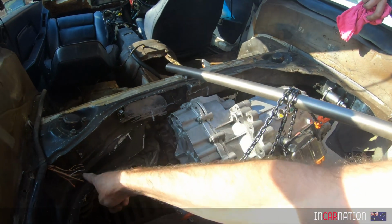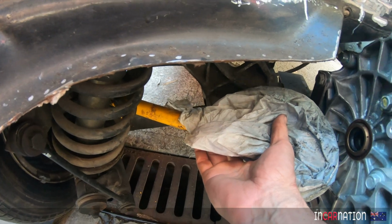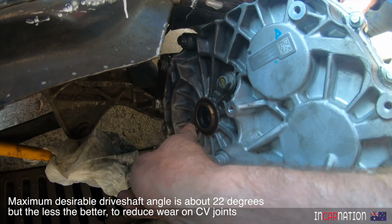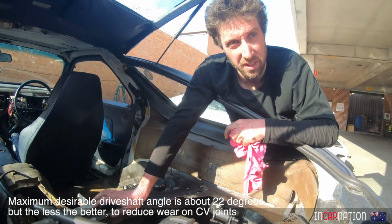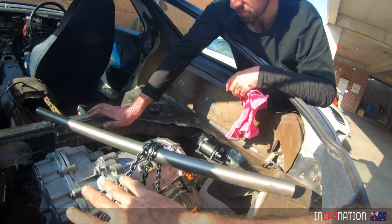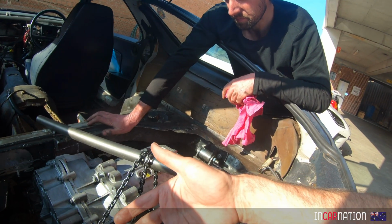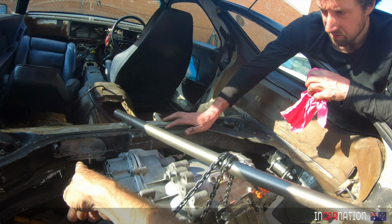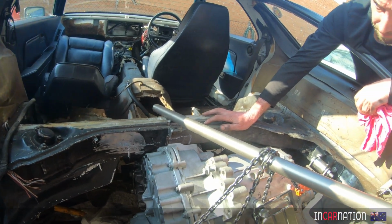We know that we've got to trim all around this and make a bit more space, but it's fouling the spring there. We can easily put skinnier springs on, but the angle's still not right to get to the hub here. It'd work, but it's very severe. Yeah, it's not good. Now, in our efforts to get the motor as high as possible, we've actually brought it back a little bit too far. We can reuse a lot of it. It'll give us a chance to tidy up all this, cut around here, get rid of more of this, which we knew we had to do anyway.